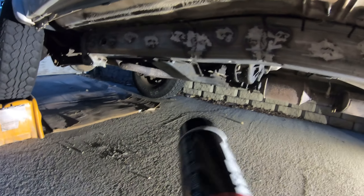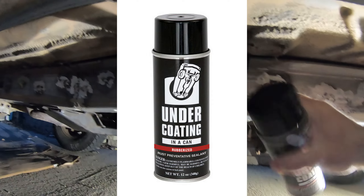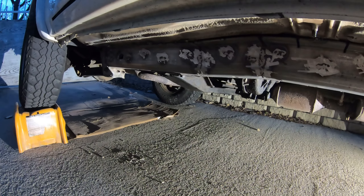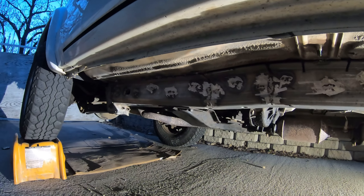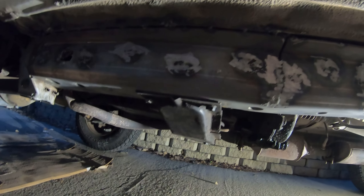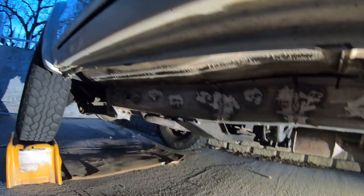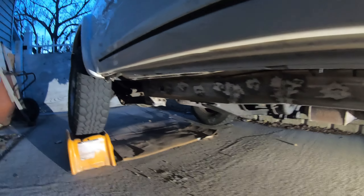What we're going to do right now is just spray the outside of the frame. I'm going to try it with this undercoating in a can — rubberized coating — because it's going on to new raw metal. There's no rust under there or anything. For the inside of the frame, I'm still going to use undercoating in a can, but out of a five-gallon pail with their sprayer. They were awesome enough to sponsor this. I want to try the rubberized here on the outside, and I'm not pulling off this cross member right now — I'll be replacing that in the future as part of the long arm suspension lift. So let's get to it.